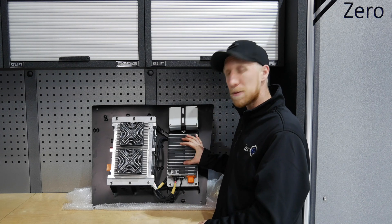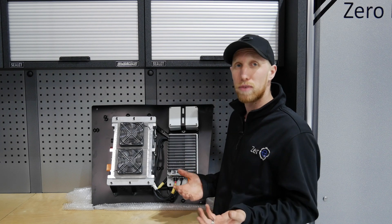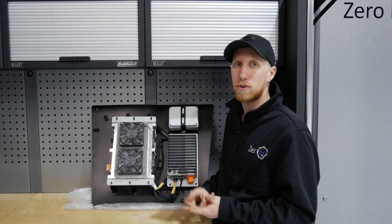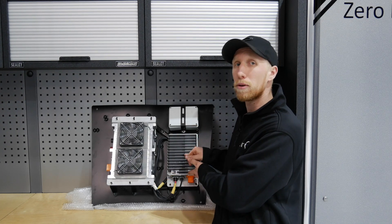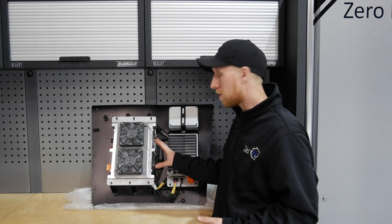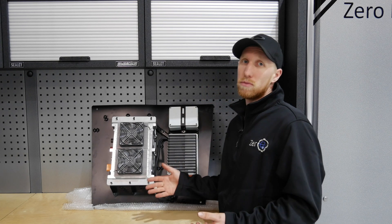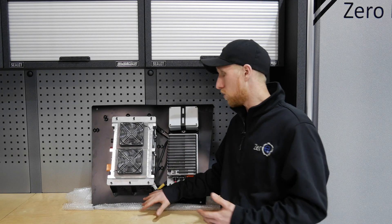This is our DC-to-DC converter. It converts our higher voltage battery down to 12 volts DC to maintain the original vehicle battery, which then maintains all the auxiliary systems — headlights, indicators, stereo — and it's also going to be powering our power steering and brake assistance. These come in a range of sizes; this one is 1.5 kilowatts, but we also do a 2.2 kilowatt Tesla version which is liquid cooled. Both of these units are air cooled, which makes installation a lot easier as you haven't got to run additional coolant everywhere. They also come in a big range of voltages depending on your high voltage battery pack.